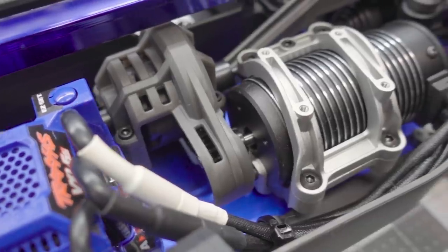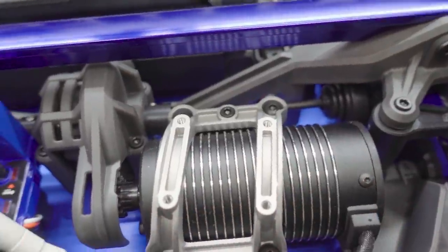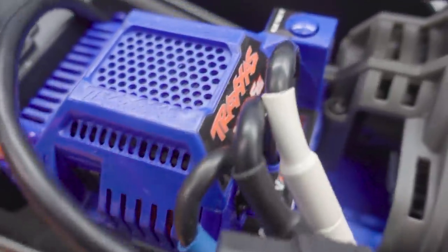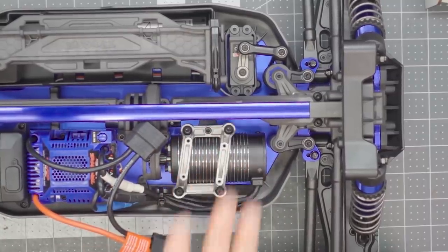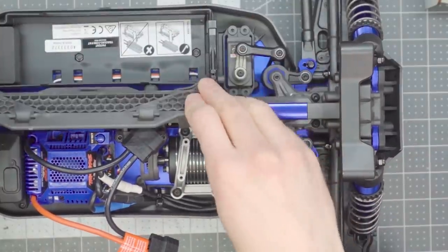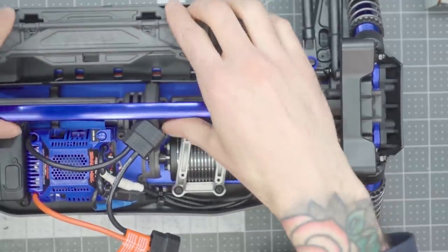Okay, 2000 kV brushless non-sensored motor mated to the Traxxas VXL 6S system. You need two connectors there because it has two batteries. They recommend two 5,000 milliamp hour 3S LiPo packs, which fit very nicely in this redesigned battery tray. You put them in side by side there. Nice clipping battery tray